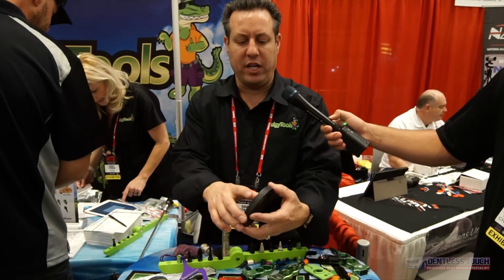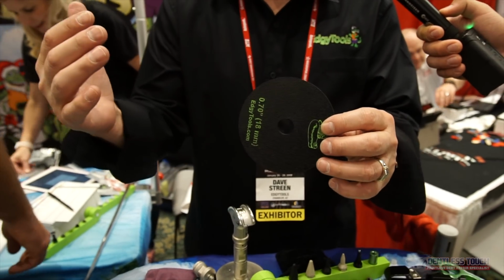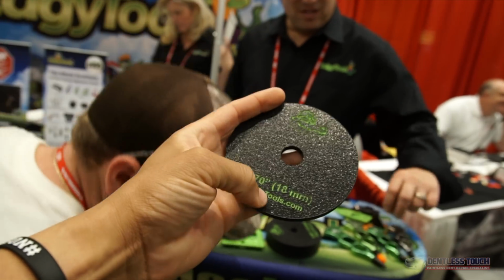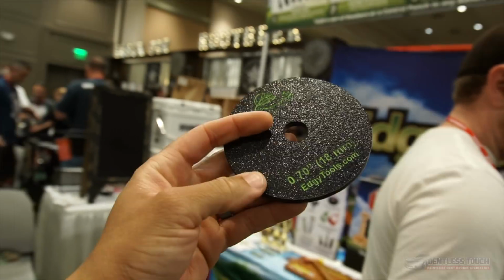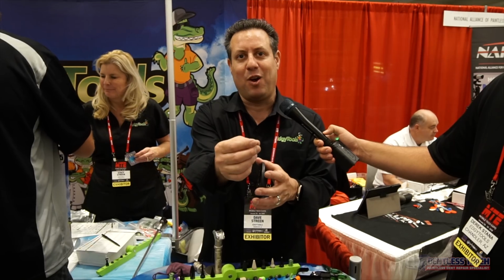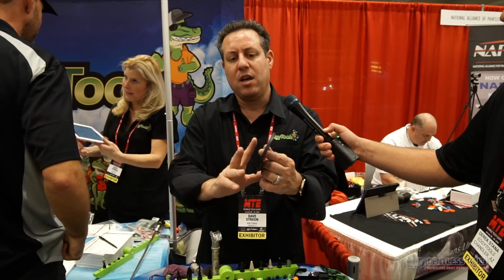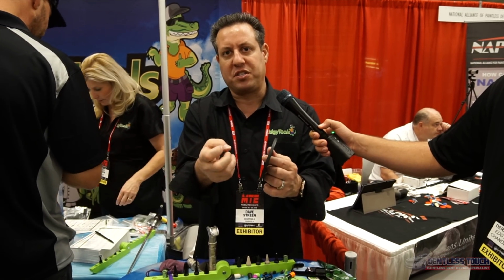Lastly, I'll show you our new honey holes. These on the sail panel, if you glue pull it, you do what's called volcanoing a dent because you're pulling the whole area up. This holds that area back. Kyle Violet came up with this and won second place in the Dent Olympics last year. You glue your tab onto the sail panel, slap this over it. It's got a magnetic back so it'll stay. Your mini lifter is going to hold the honey hole down and just pull the center of the dent up.